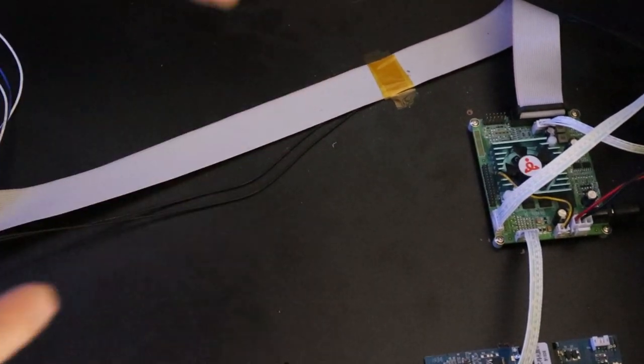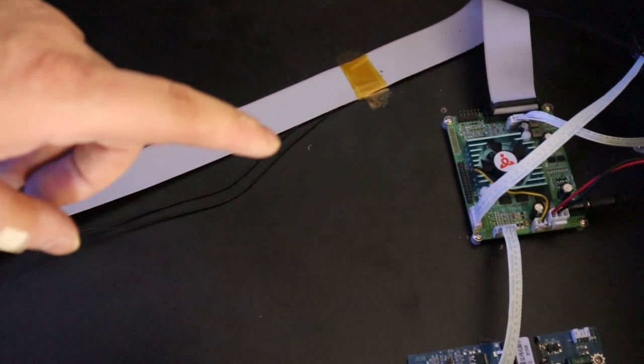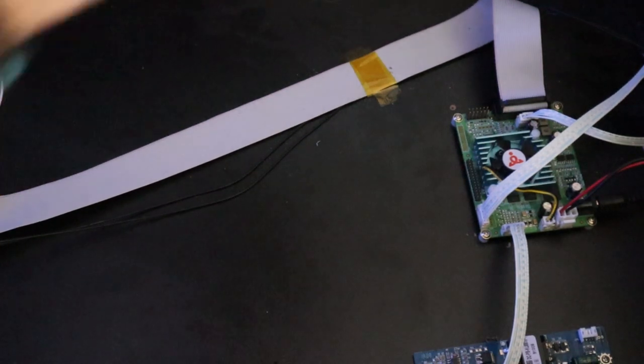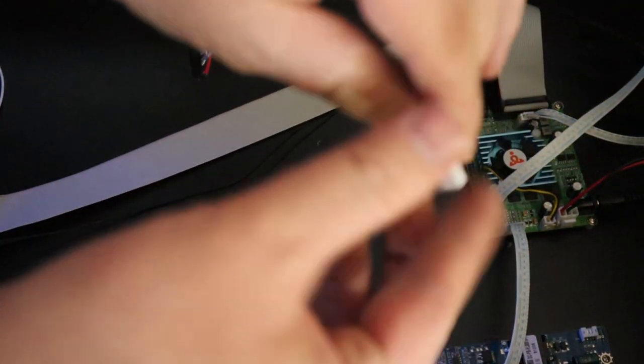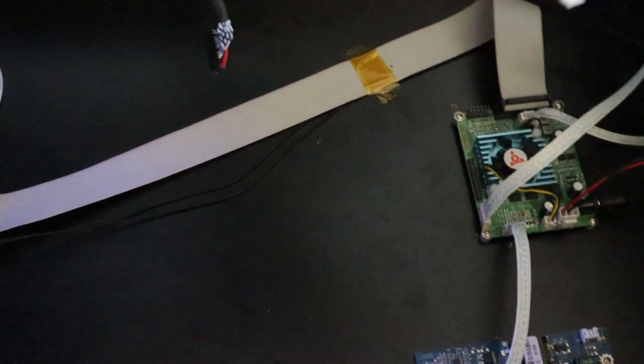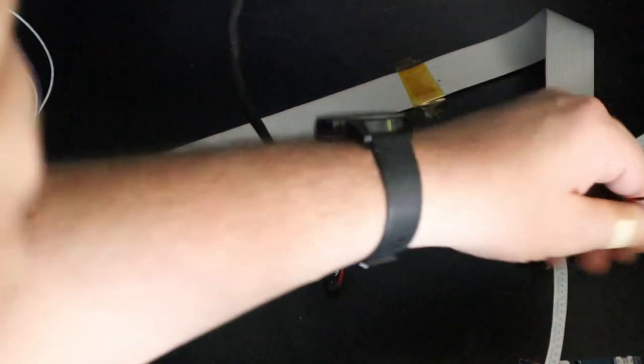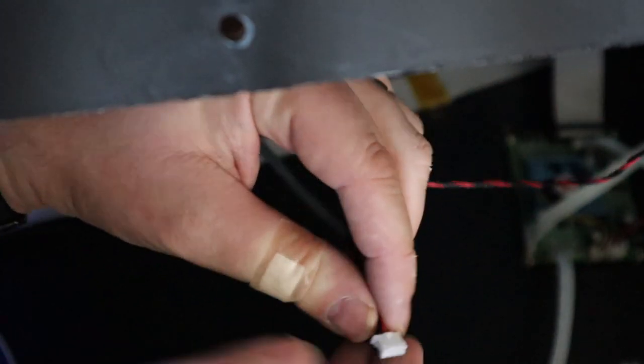Okay guys, now to recap — you've got to get your monitor plugged back in. You might need two people. Make sure the power cable for the monitor goes there, and the LVDS cable goes there with the red wire pointed to the right. It might be nice to have someone hold the monitor for you, that way you can get in here and get these wires plugged in. In this case, I do have someone holding the monitor for me while I'm in here trying to get the cables plugged in.